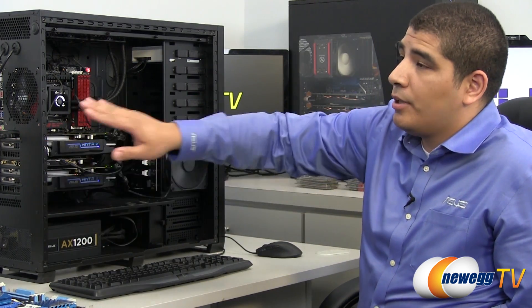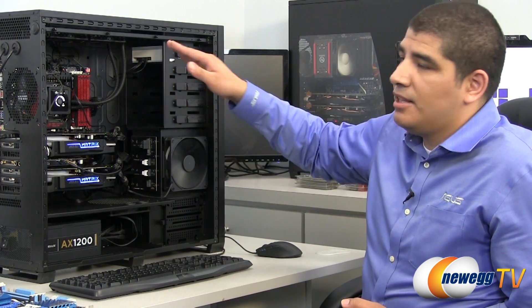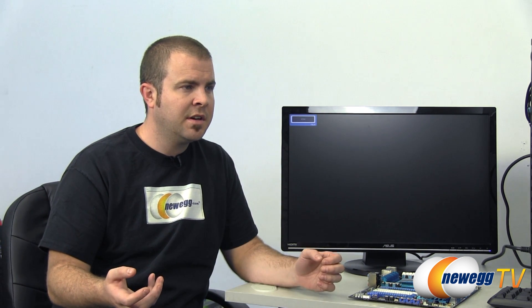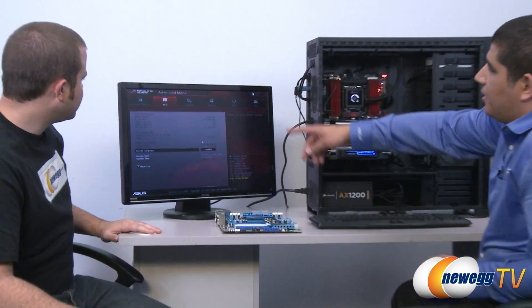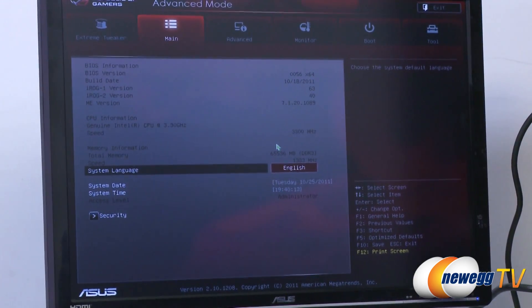We still see essentially nothing on the screen, but that doesn't mean the flash itself wasn't successful. I imagine in a situation where you had an older motherboard and a newer CPU and you weren't sure if they were compatible, or you needed a BIOS update to be compatible with a newer CPU release, this would be a great method for doing that without having to obtain an older CPU to get the board to POST. That's 100% correct — you could definitely stop that issue because it's normally like a chicken-and-the-egg problem where you can't do one without the other. We can see we've completed the BIOS flash and we're now at build 0056.